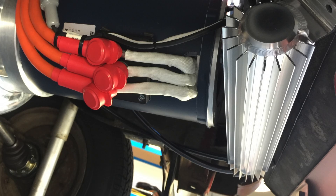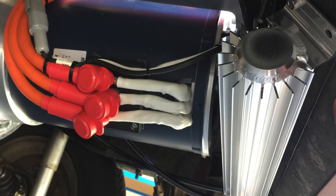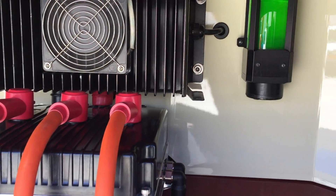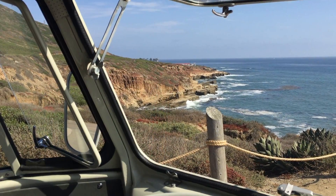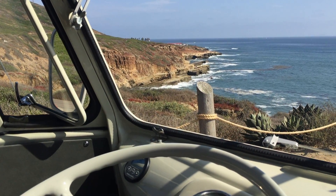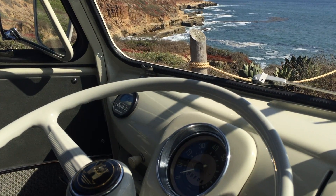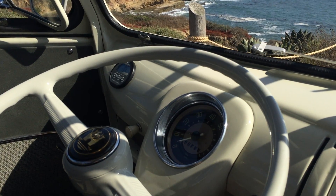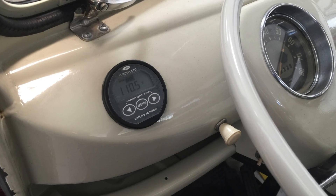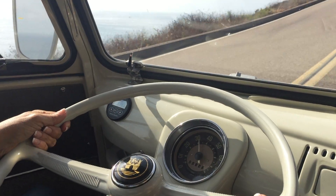Underneath the bus we have an air-cooled finned radiator. The coolant runs through that, runs through the controller, and keeps everything working at peak performance. There's not much going on in the dash — it's really minimalistic, and that's kind of the wonderfulness of it. Very simple. Our client opted for no radio here, but in most of our builds we do add them. We replaced the traditional fuel gauge with an electric battery meter so you can still figure out what your range is going to be.